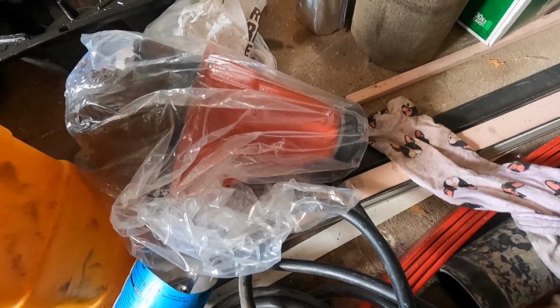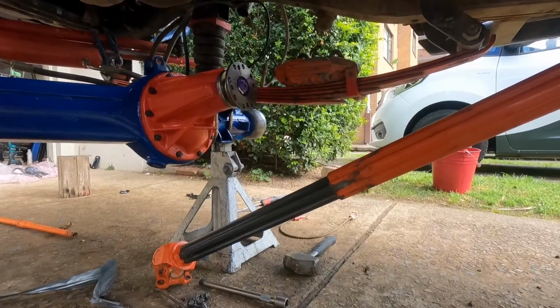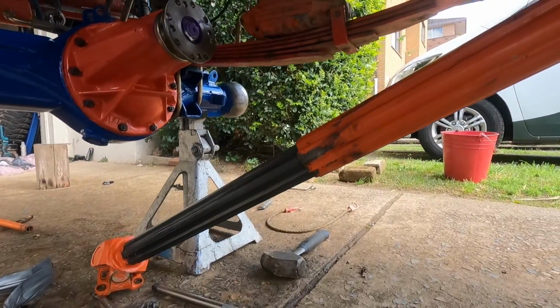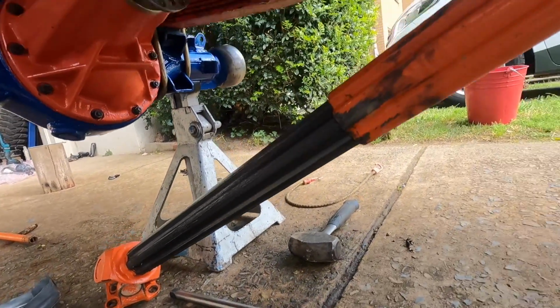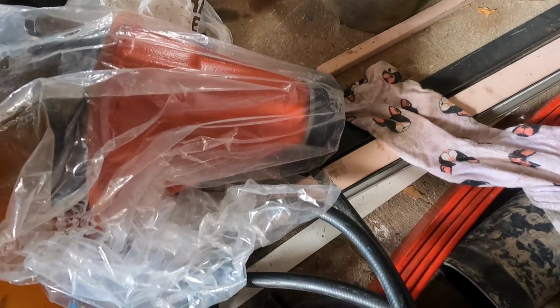But what we've got, because we've got that long slip tail shaft at the front, we've got enough length to run a normal low pinion setup. So I've got Brian to put the 80 series flange on that to suit the 80 series uni that we run in this tail shaft.